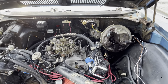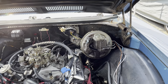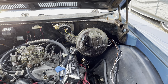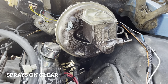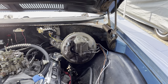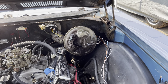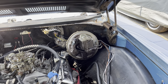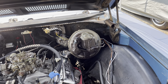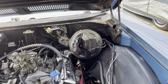I'm about to run to the store here real quick, but I did want to show you this rust neutralizer that I use and it is awesome. I've been using it — shoot, maybe since I was about 20 years old. It's already neutralizing the rust and turning black. You're supposed to wait a full 24 hours for it to cure, then you can sand it and paint over it. You can actually primer it then sand it, or you could just spray paint right over it.